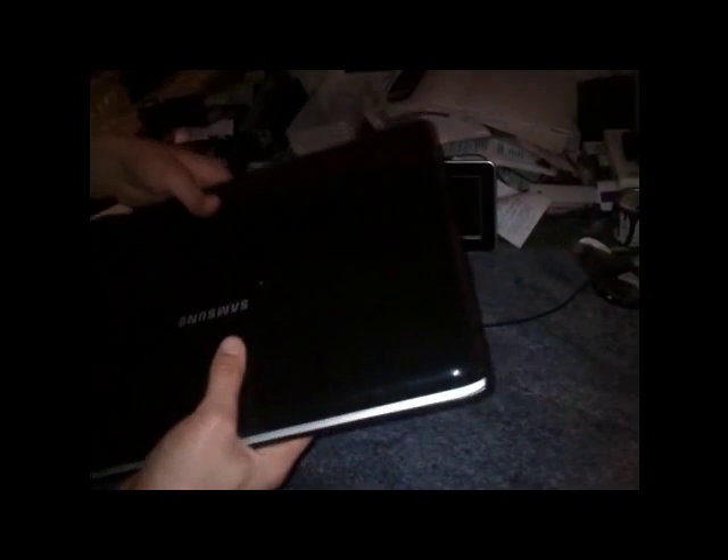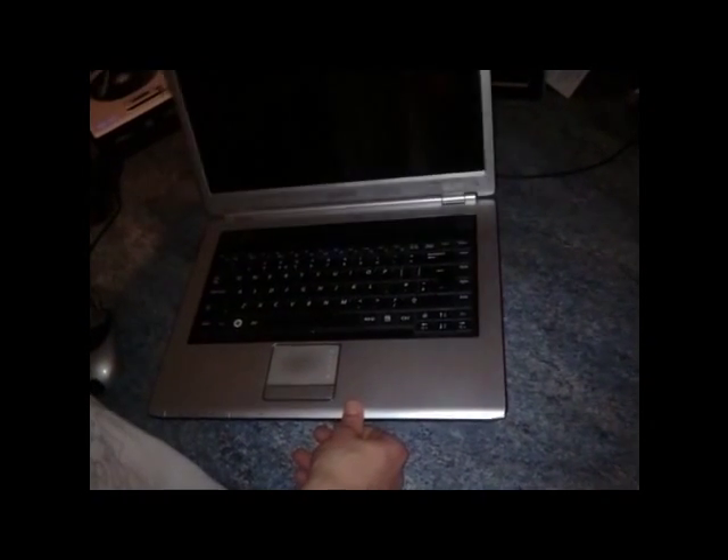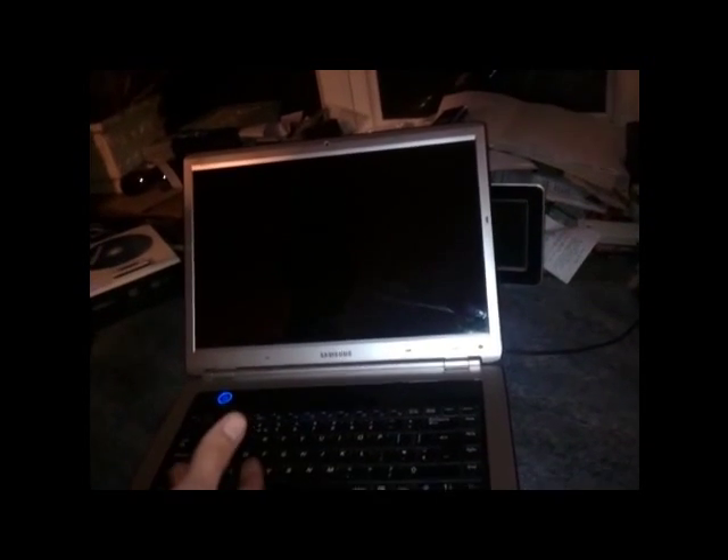Now I'm going to put the battery back on this one. This is my laptop. Obviously I'm a bit more of an advanced person. I like a choice between Windows 7 and Ubuntu. I'm going to fire my laptop up — I'm pretty sure this is going to work. I'm going to go into Windows 7. Whilst this is loading up, I'm going to show you the specs so you know that I've installed 3GB of RAM. Obviously it's going to show up as 2.75 because the graphics card on this allocates 256MB of RAM, which makes it a quarter of a gig. That's used as video memory to run applications that require graphics — you can work it out, it's pretty simple.